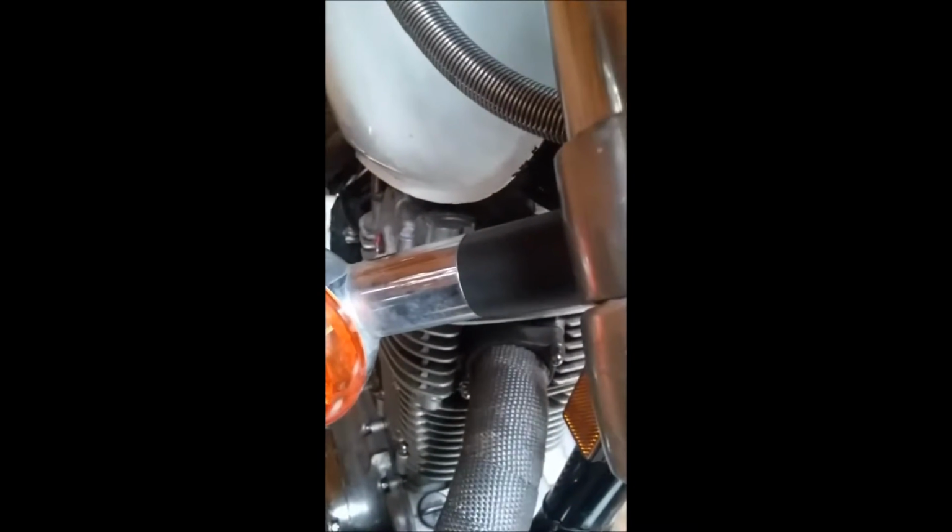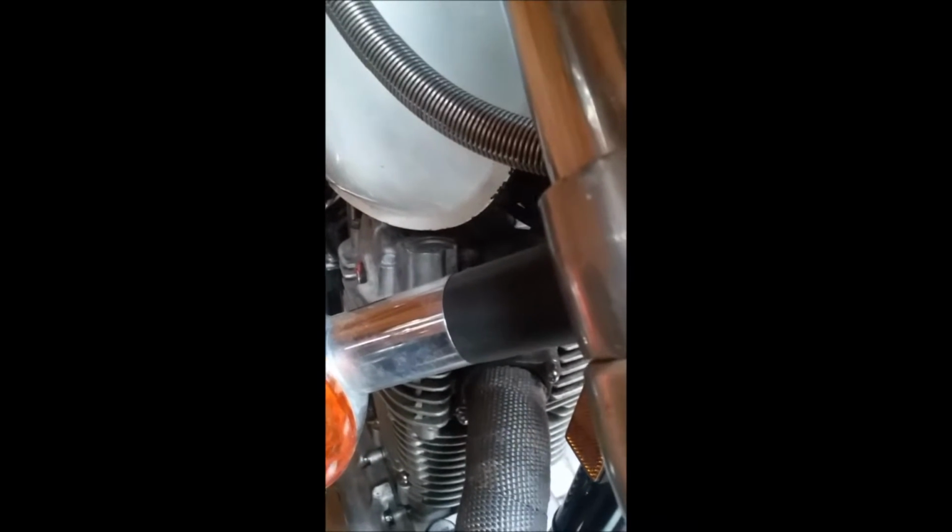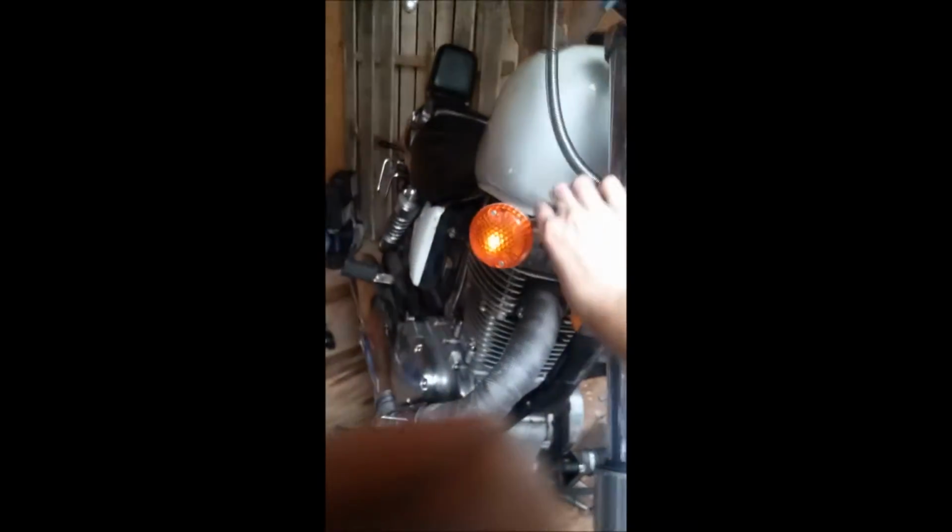Standard wrench, I wouldn't bother, not standard wrench, but metric wrench. I wouldn't bother trying to get a socket up into this. It'd just be a pain in the ass. So just do this on both sides. You don't really need to take it off. Well, I mean, you can if you want, but the only way you're really going to get this out of here is pulling the forks anyways. But we just want to loosen it up so when we slide the forks out that they won't be attached. Alright, so we've loosened the directionals on both sides, taken the fender off, the caliper.